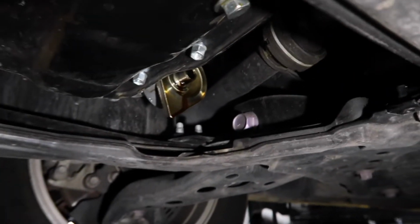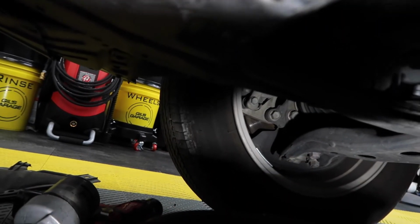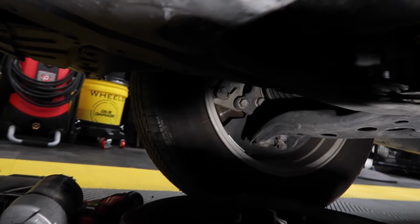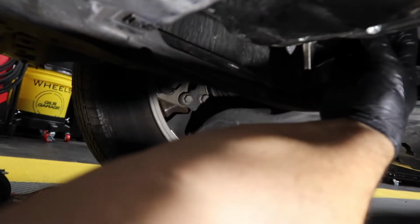Where the oil filter was, it's gonna be dripping a bit. So you just grab your dirty oil rag, clean it up a bit. Grab the new oil filter. So the old brand was Fram. This one is Wix. It's pretty cheap in price, and supposedly it's really good for the quality. So make sure you hand tighten it.